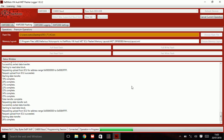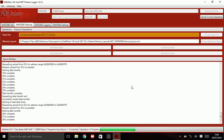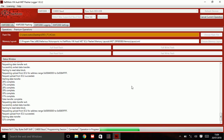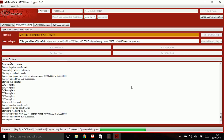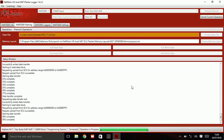I also forgot to mention — make sure that the air conditioning is off, the lights are off, the headlights, things like that, and also your interior lighting is off. This will help bring the voltage up to 12 volts and above and stop other things pulling current from the battery. To make sure the communication is stable and you don't have any voltage drop causing bricked modules, turn all the interior electronics off, pull out your dash cam or 12-volt charging port, but obviously leave the ignition on the entire time.